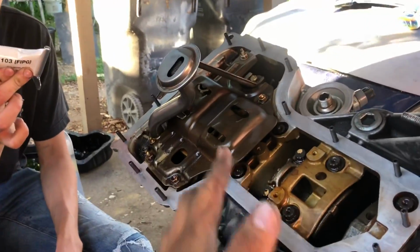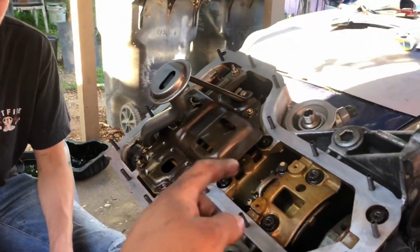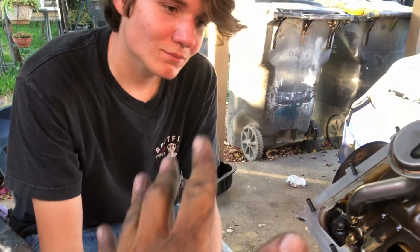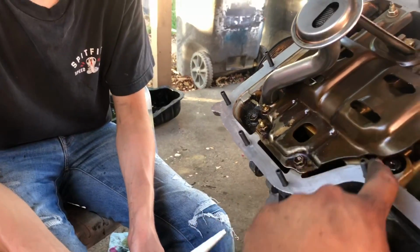Okay, Clayton, since the last video I made about the 2ZZ oil pan, a lot of my commenters were like, oh, you didn't install it right. You went on the outside of the threads. But little did they know, I did it on the inside a second time around. And so I got flamed really bad on the comment section. So now this is me telling you, when you're applying the RTV, go on the inside of the threads. Does that make sense? For sure.